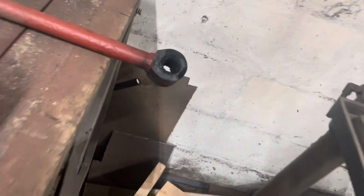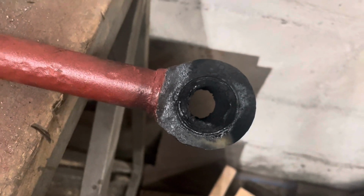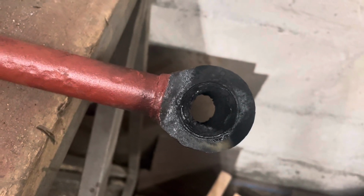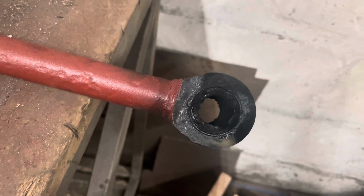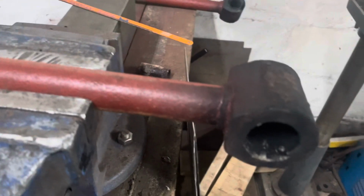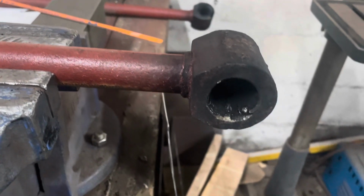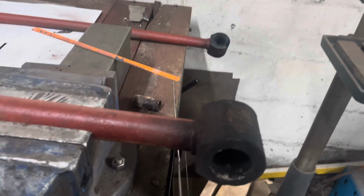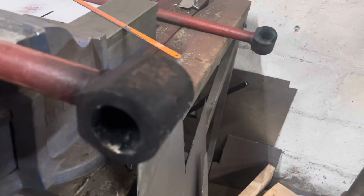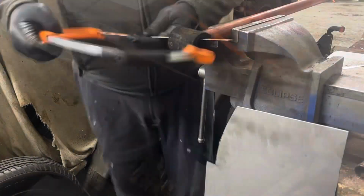That one's a little bit further behind. Got the inner sleeve out. I've been burning the other rubber out. So the intention is to try and cut through this first one, and then I'll try and cut a slot, or a couple of slots, in the rubber of the other one, so the next time I hit it with a heating torch, with a bit of luck, it'll start to perish quicker than it has up to now. Anyway, on I go.